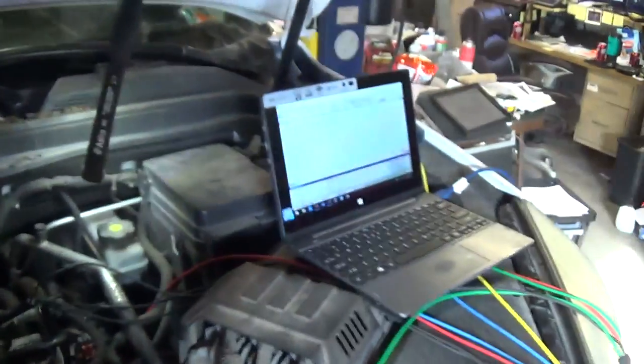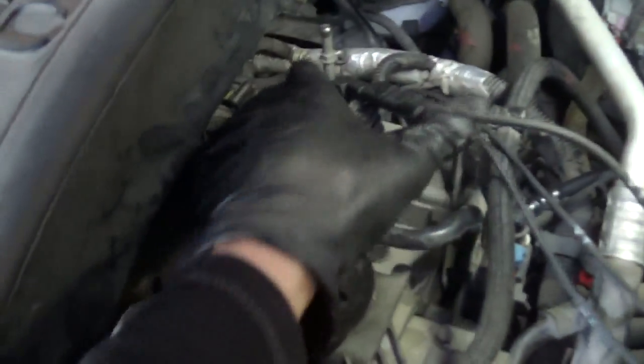So when we run the bidirectional test, we'll see how this command correlates to our shift in our camshaft. And if you notice, I actually have both wires back probed, the yellow and the black, for this channel. And that's because the Pico has isolated grounds. So the other three grounds we have stacked on a metal stud, those are connected to body ground.